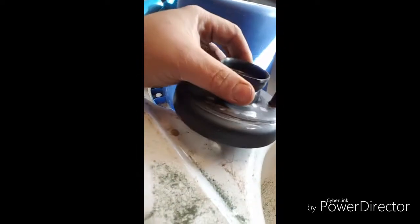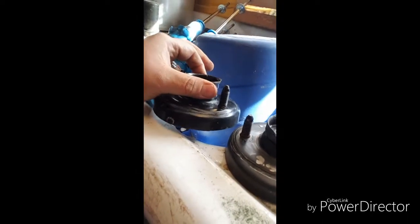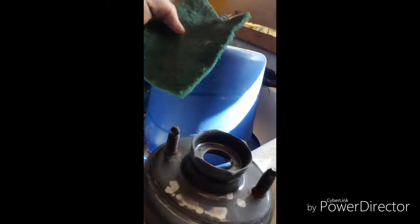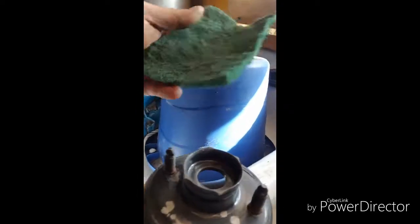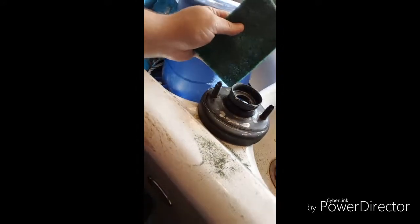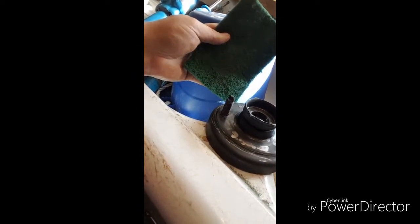As you can see, this one has a dull finish. This one isn't completely finished yet, but if you look compared to this one — see how this one's still shiny? The Scotch-Brite pad is almost like a super fine sandpaper. Just be careful because it leaves dust residue you'll need to clean up. That's what I'm doing now — scuffing these up so I can shoot them with paint.